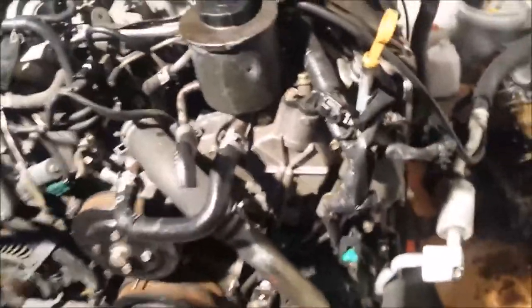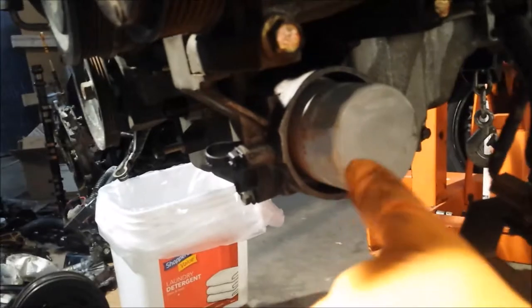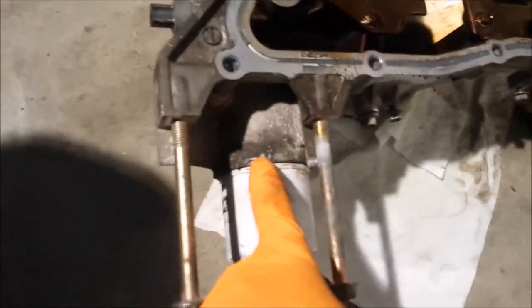I have another video discussing the spark plug tube and dipstick in detail, but I'll briefly discuss the difference here. This is how you know you've got the older one: the oil filter is a little sunken in there — that's a 2003 style. The 2006 oil filter is flush with the mounting surface. It's a really small oil filter, but it mounts flush.